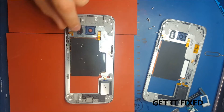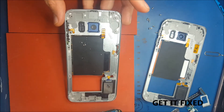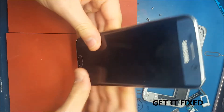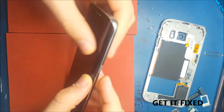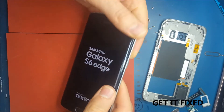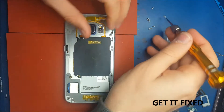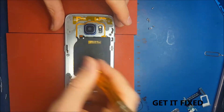So let's have a look. First, make sure the bottom with the charging port is properly seated in, because the top will just fit normally — it's quite easy to push in. Before you make the test, I would suggest you close the phone and put all the screws in, so you make sure everything is connected to the board: the power button, the volume button, and the speaker as well.